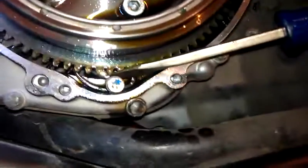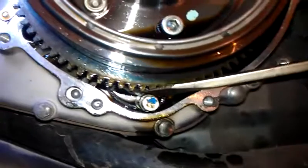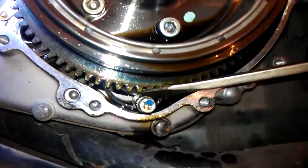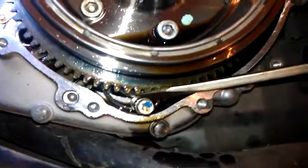What I'm going to do is manually push it towards the spring side, then tighten this 8mm bolt. I'm going to reassemble it, test drive it, and see what we get. I'll let you know.